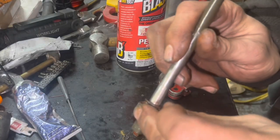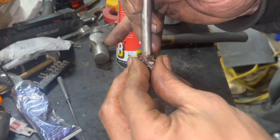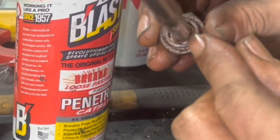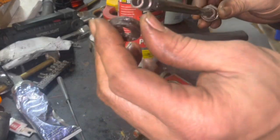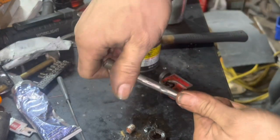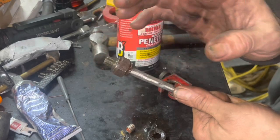How these clips work: position it where there's not a window, so when you push it down you're pushing straight into a window on each end with the window in the center. It's extremely important that when you look down in here, you can see all three legs of the clip. If you can't, the clip can spring back. As long as the clip cover is not broken, make sure you put it on. If it is broken, use a really small zip tie to secure it so your spring doesn't pop out. Then make sure the end spins freely — if it doesn't, take it out and sand it a bit more.